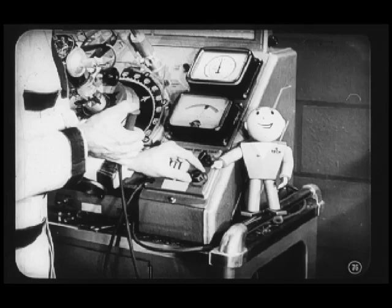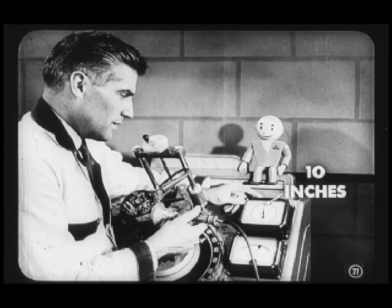Right, Tech. Now, with the pump turned on, place your thumb over the end of the vacuum hose and adjust the vacuum to read about 10 inches. After you've made this setting, keep your hands off the control knob while you make the test. Connect the hose to the adapter on the vacuum advance unit and check the gauge. It should read 10 inches, like this one does. Any reading lower than that would indicate a leak in the diaphragm and you'd replace the unit.